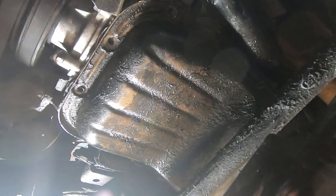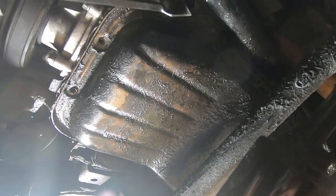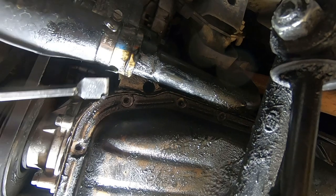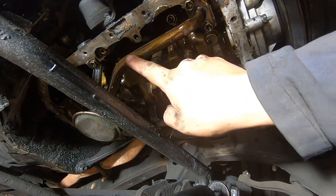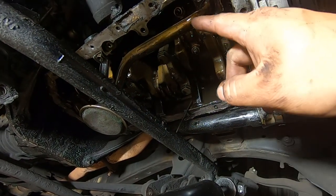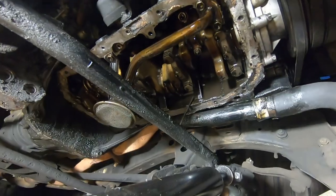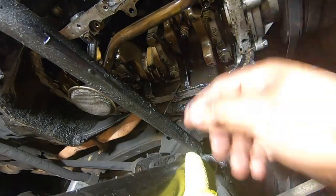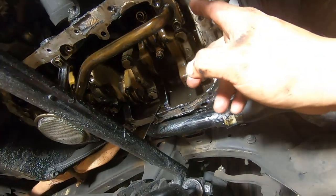Now we're going to shove this in between the engine and the oil pan — make sure you don't scratch the engine block. We installed RTV the first time we did this, so it's going to be a little difficult to get off. It took us a while but we were able to get it out. This is what it looks like without the oil pan. There's a little bit of RTV on this from the first time when we slid the deep pan in and got on the pickup tube.